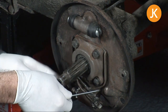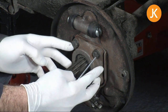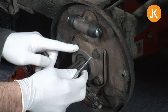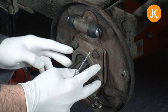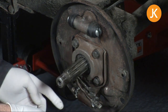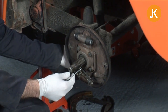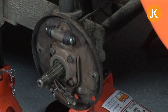We've removed the brake shoes now and given everything a very good cleanup — got rid of all the goo. It's this plate here, the hub carrier, that we're going to be taking off. Behind it is the seal that stops the gearbox oil from coming out; the gearbox oil travels up and down the solid shaft on a swing axle and lubricates the rear wheel bearings. If we take it off now the oil is going to gush out, so we're going to carefully put the jack underneath down by the lower shock mounting and raise it gently, without lifting it off the axle stand.